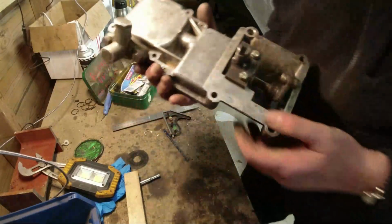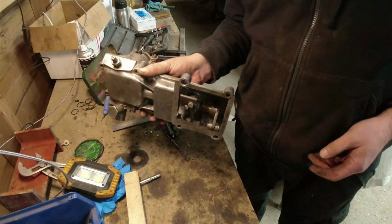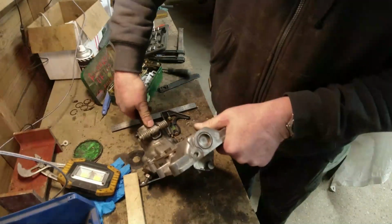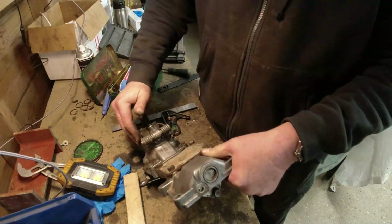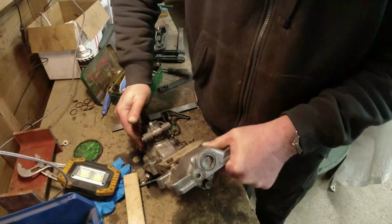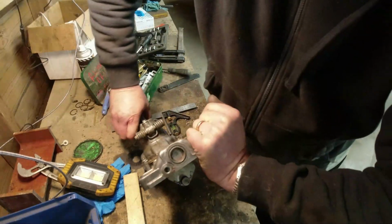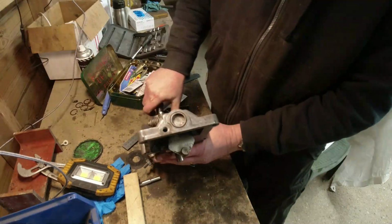Let's go and show you what it looks like when I've got it in the car. I'm going to go and slap it in and check it works. Basically, the way the selector works is you've got third gear, fourth gear. You can see the way it slides back and forth. If you want first gear, that is over here and then up, and then second is down, over here, then down. The thing basically moves back and forth, but by moving the selector one way or the other, you can see it actually pivots the yoke. Bit of a cack-handed way of showing it, Richard.